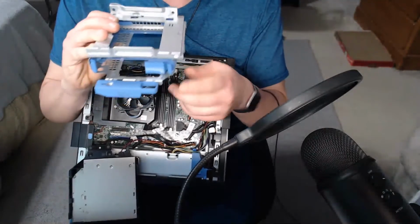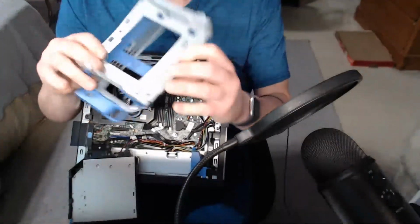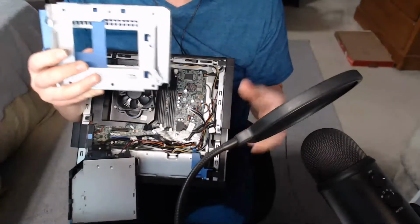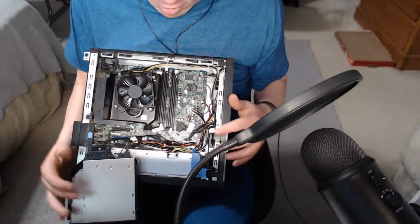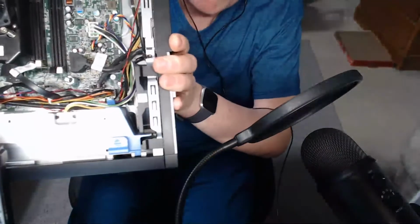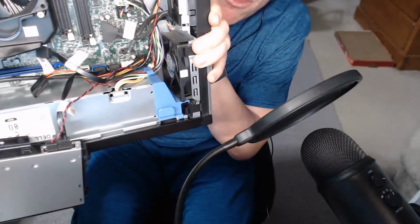Now, believe it or not, there is enough space, if you use a slimline desktop hard drive in there, to actually put an SSD on top here. If you look, there are some screw holes, one there and one there, so you can mount the SSD. But you're probably thinking, Matt, how many SATA ports do you have on this? On the bottom here, if you look really close, you can see there are 3 SATA ports: the blue, the black, and the white one that's not being used.